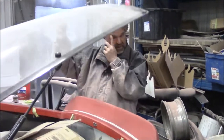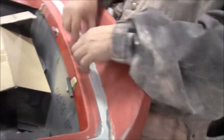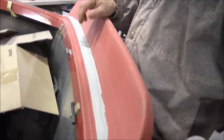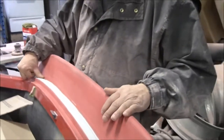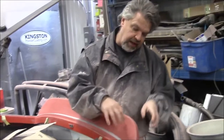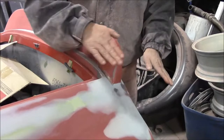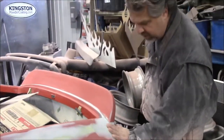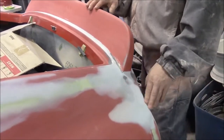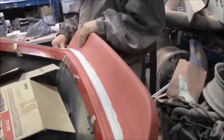What we've done is fiberglassed it in — we glued it first, then added the fiberglass matting as shown in the earlier video, then sanded it all out, added some body smoother, and started blocking it out. We don't have the crazy ripples anymore or that big bump, because we tapered down the fiberglass and feathered it out. There's not a whole lot of body filler here, and it's a much nicer, cleaner look. It's quite a bit smoother overall.